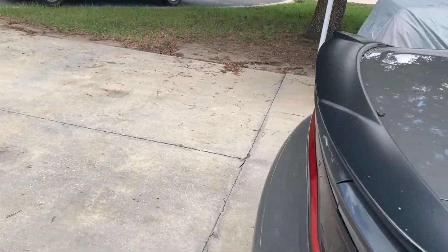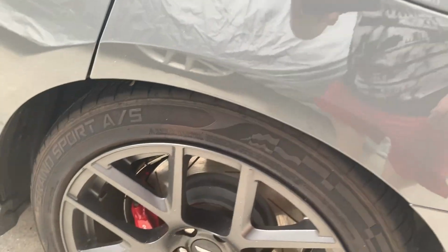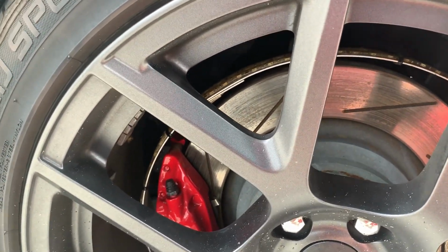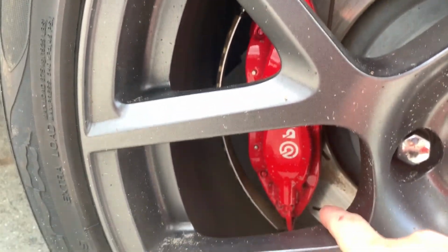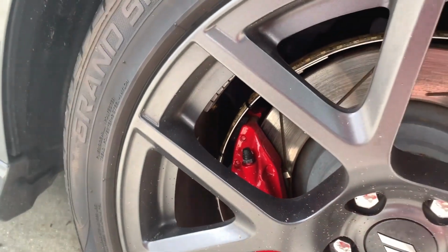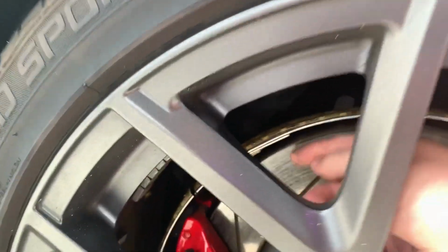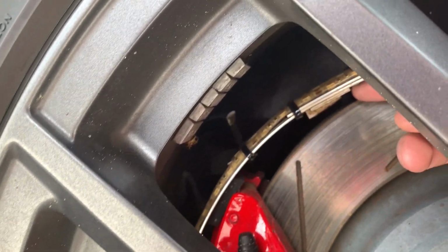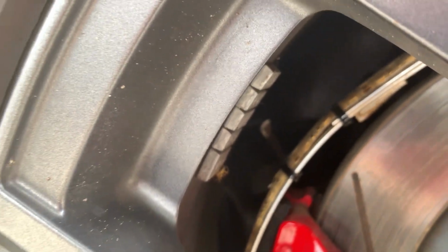My biggest concern for the lights is this wheel light right here. Now this one right now isn't even working. A while ago while I was driving, one of these little brackets we had to make right here, there was another one that used to be down here holding it on. The wheel light actually broke, so it was smacking around. Oh, there it is right there, there's the bracket that broke. While this was slapping around, it ended up ripping that wire out. You can see right there. So we have to reattach that to get this working.